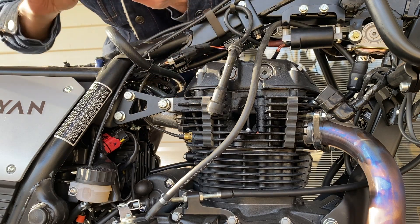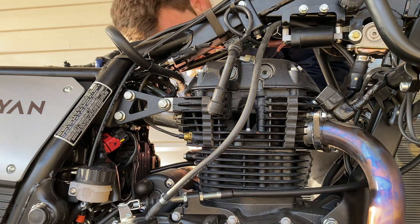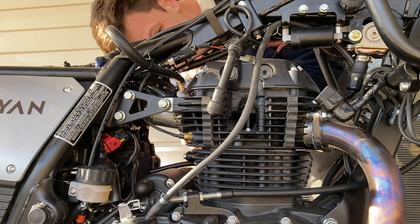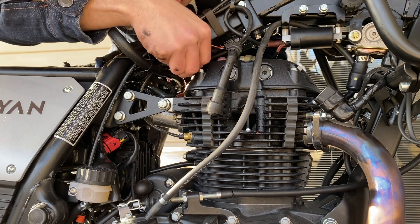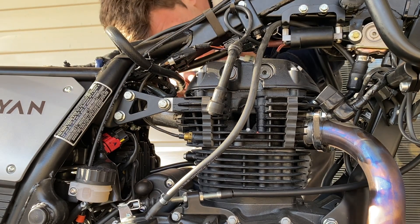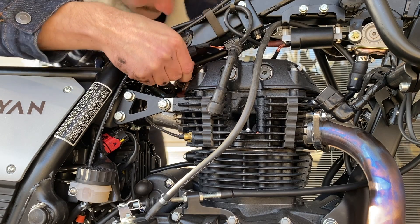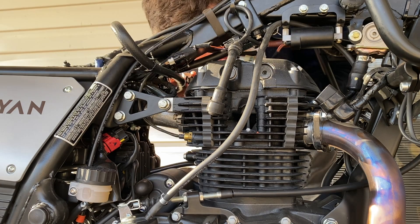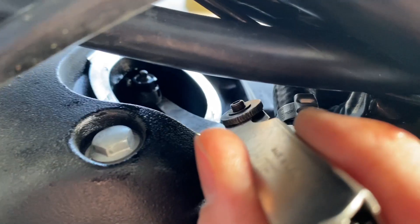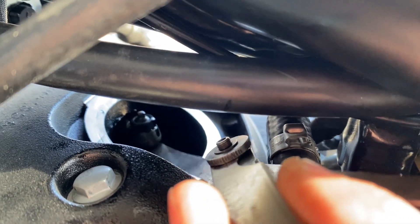So we don't lose that gasket on the intake valve. We want three to four thousandths of clearance. Here is my four thousandths feeler gauge — I've used these a lot and broken them a little bit. Four thousandths will not go, and three thousandths will not go either. We've got three thousandths and it will not go, so we'll have to adjust that valve a little bit.